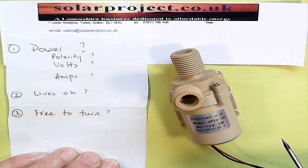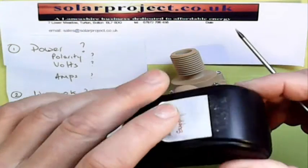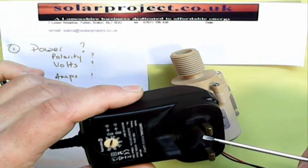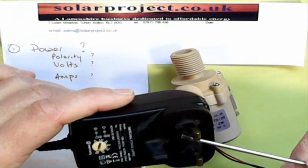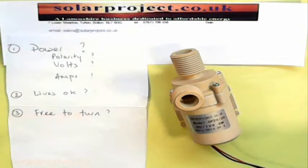If you're choosing a plug-in power supply, I would go for one rated at one amp or more to be safe, because you don't want a power supply running at 100% all the time — it's much more likely to break down.